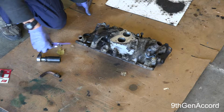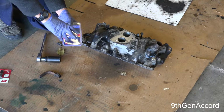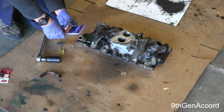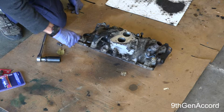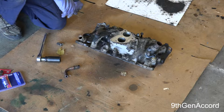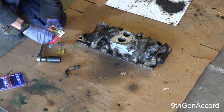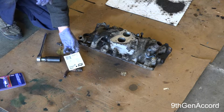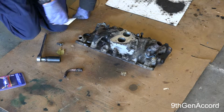I'm going to put a link to this in the description. This is what Chevy, or GM, used to use. This is just a 5/8 inch heater hose fitting. And I suspect they went to this quick connect, if you want to call it that, push lock, because it's easier and faster to assemble. There is a special tool that Lisle makes. I'll put this in the description. It is called the heater hose coupler remover.